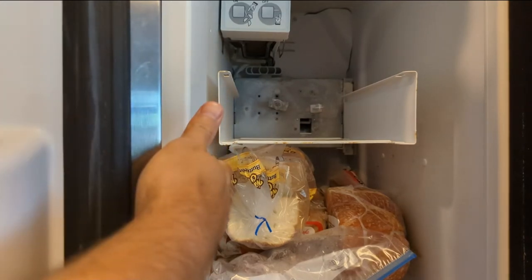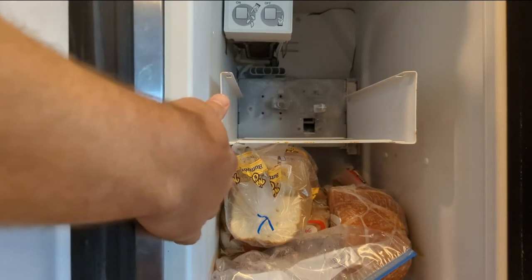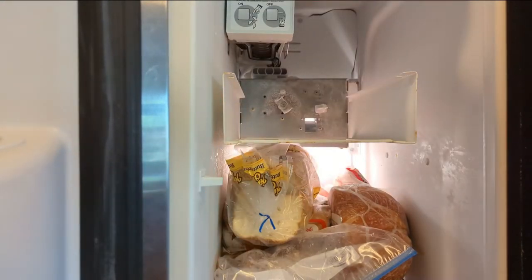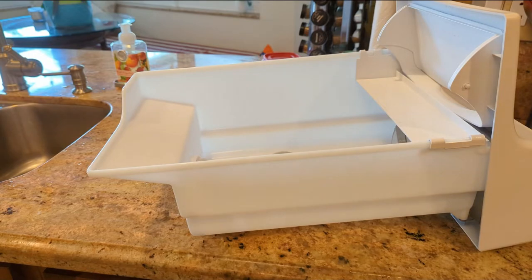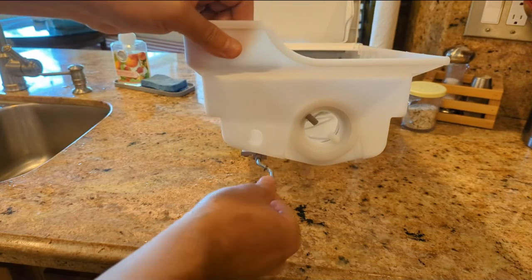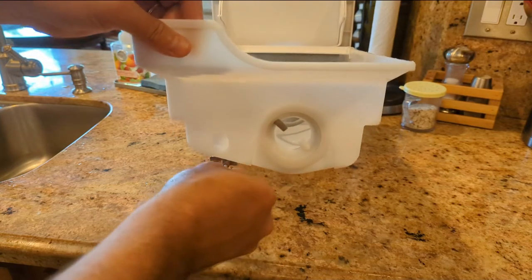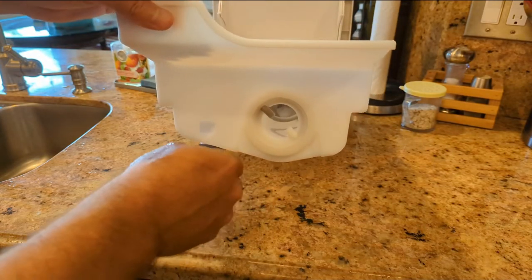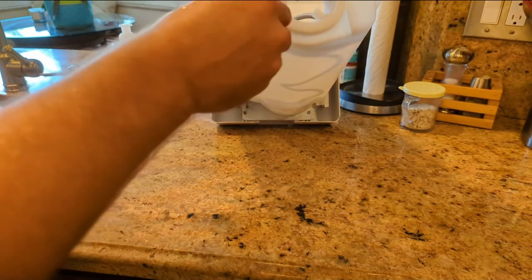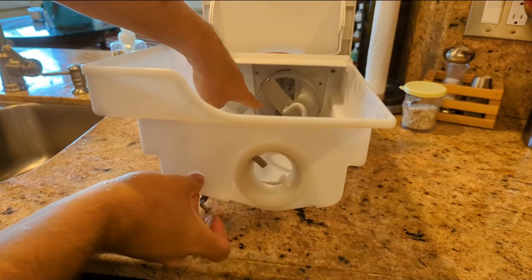You can see it moving up and down. Actually, it's not moving up and down now. Interesting. So I emptied out the ice tray and put the ice in containers in the fridge for now. So that little solenoid moves this lever here - seems to move fairly easily. This controls whether or not you get cubed or crushed ice. You can see when you actuate this lever it opens a door over there, and that's all moving freely.